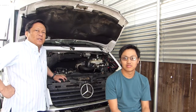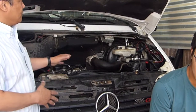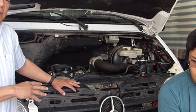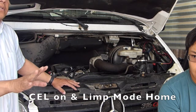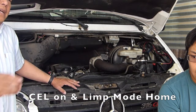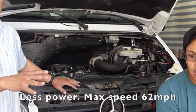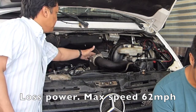We just got back from a trip to San Diego — about 300 something miles round trip. During the trip down there, the Sprinter started developing a hissing noise. Obviously it's an air leak in the turbo system somewhere. After about 15-20 minutes of steady throttle, the hissing completely went away and the engine light came on and the Sprinter went into limp mode home, LMH. So the leak could have been anywhere, including the intake manifold, which is this aluminum piece.